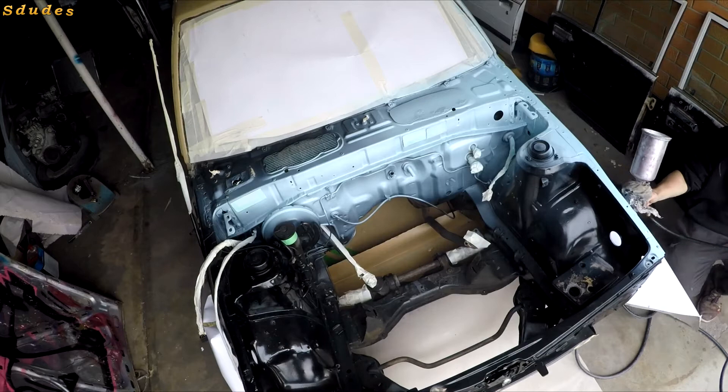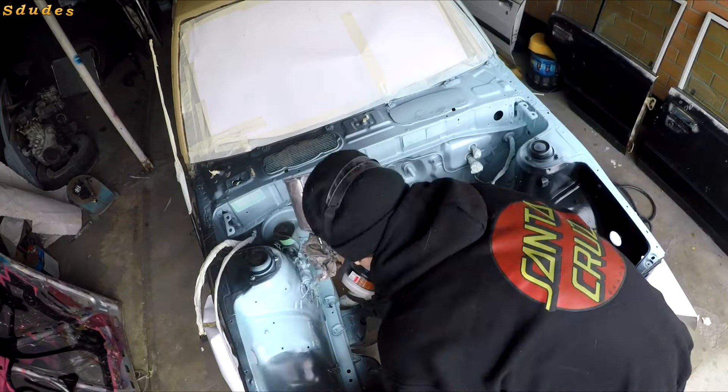We've run into a little bit of a problem. After doing the first side, the compressor is starting to go on its way out — it's not coming on anywhere near as heavy and it's not pumping air as much as it should. I'll keep going, it just means it'll take a lot more time as I'll be stopping and waiting, which kind of sucks. If it were base coat or actual color I wouldn't use it, but since it's only spray putty it'll be fine — just got to wait a bit extra because it's going to be sanded down later anyway.